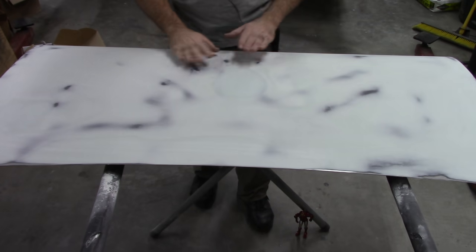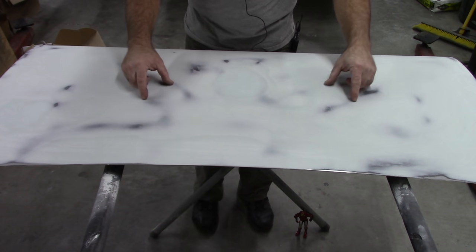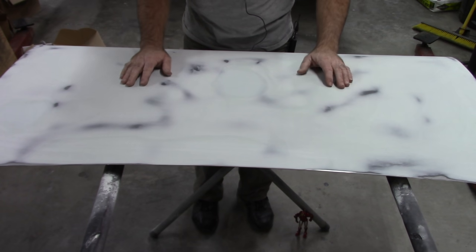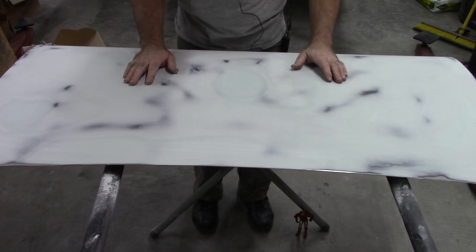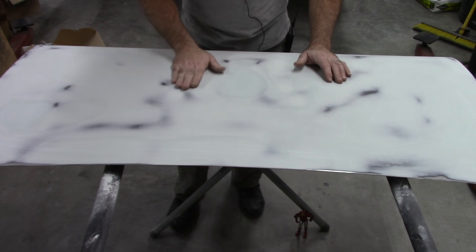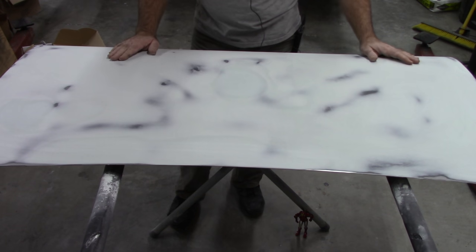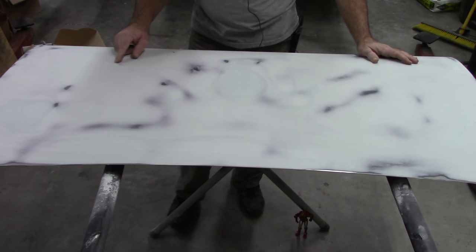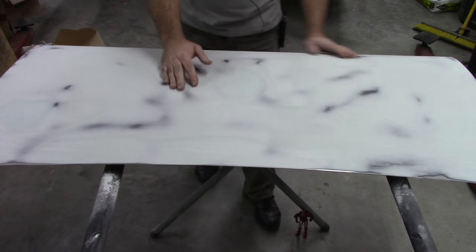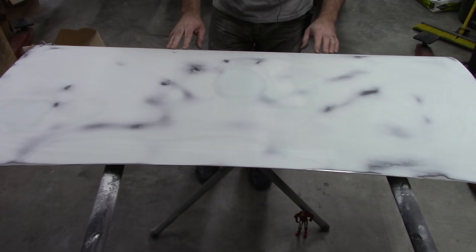Well, I think I'm done with the block sanding. As you can see, if you look carefully, the black pattern here is actually where the inner brace is. So over years of closing the trunk lid and different things, that seems to have left quite the impression. So even though this whole thing is covered, it really doesn't have that much filler on it. You can see all these dark areas where it's coming through. And I also did the front edge, or what would be the rear of the deck lid as well. And I'll show you that in just a minute.